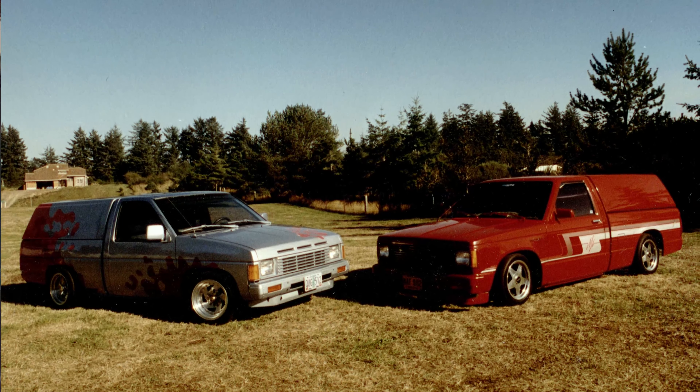Those two buttons you don't recognize are the loud buttons. Originally when I got this dash it had kind of a wood grain look to it. These instruments are VDOs — special order instruments, and they're weird in many different ways. You can't get these in the States; I think these actually came from Germany. What's really strange about them is they're in miles per hour. These are 100 millimeter gauges and they actually fit the factory holes in the dash, so all I had to do was make cutouts for the turn signals and that kind of thing. It looks so original, and yet I have my digitally calibrated speedometer and odometer so I can mate it with the six-speed manual I have in here.